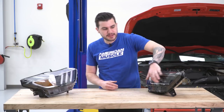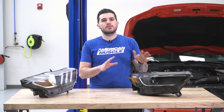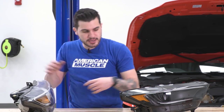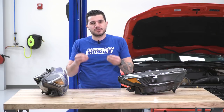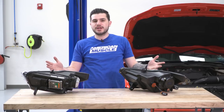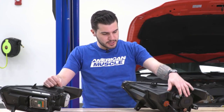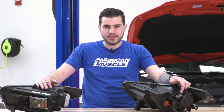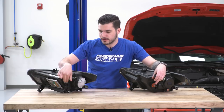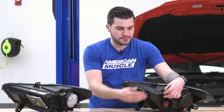The other alternatives might not offer a smoked option, and with a black interior housing here, compared to a lot of chrome trim on the inside of the factory headlight around that projector-style bulb, this one has a similar camera lens-like detail but it's completely blacked out. You're still getting a DRL that runs around the corners, giving you that nice LED bright white accent light all day. It also features your turn signal amber reflector, which is more jagged and modernized compared to the smooth-edged factory one. On the back end, you'll see adjustment screws - a Phillips head that adjusts the angle of the headlight. The plug-and-play connector just has a harness coming off about four to five inches that plugs right into your factory harness.